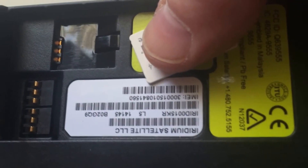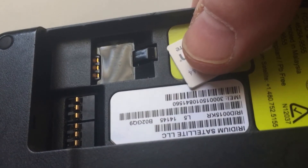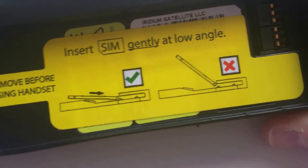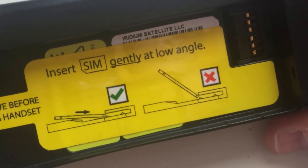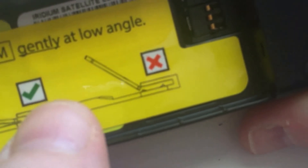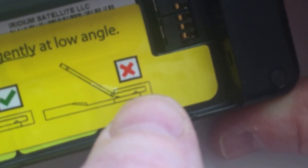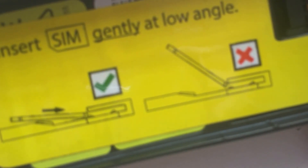Using the pen like that works very well. If you have something sticky that you can put on your finger, that's great too. The pen works because it doesn't apply pressure on the SIM card readers. Now, Iridium has added a guide on the new 9555s showing how to run it along that track just as I showed you. It shows the correct method with a green indicator, and a red X showing what not to do — which is putting it in at an angle. There are readers in the front and in the back, so insert it the way I showed you.